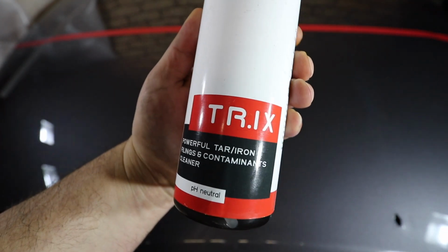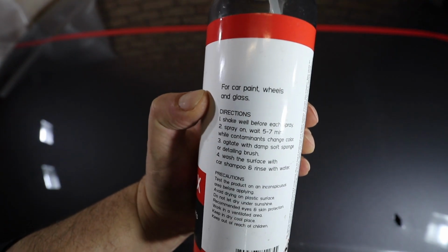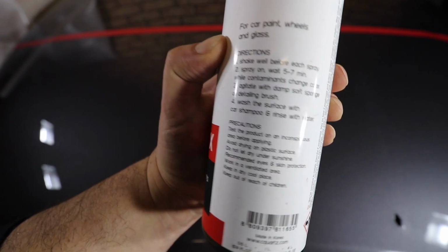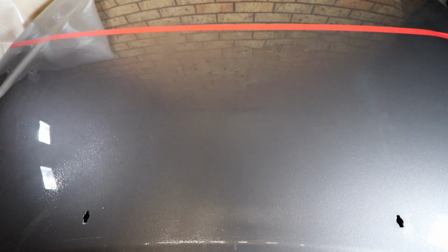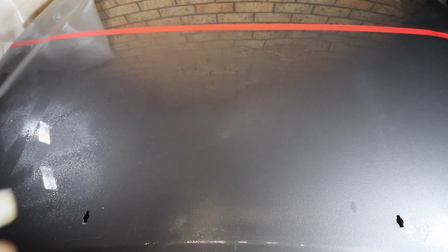Basically, it removes not only the vast majority of environmental fallout and traffic contaminants, but also greatly aids in removing or at least reducing the amount of any existing waxes or sealants, which ultimately greatly slow down the paint compounding and polishing steps by gunking up your machine pads and altering the effectiveness of your products, as well as potentially limiting the quality of the finish.